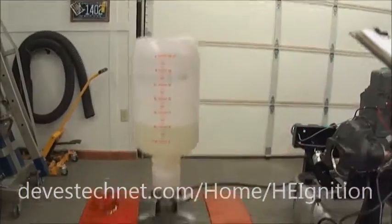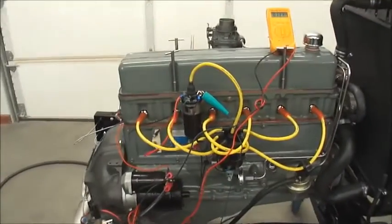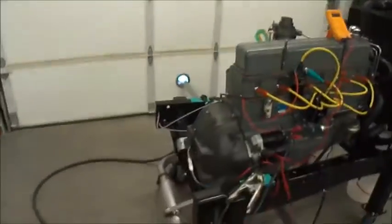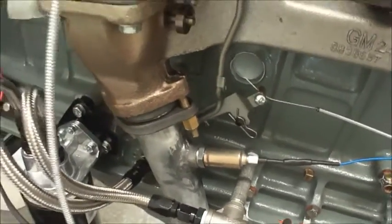As you can see, there's a bottle on top of the gas tank that has the ounce gradations, a standard set of gauges, and we're going to include an O2 sensor in this project. The O2 sensor will be read with a Fluke multimeter. It's a narrow band — I made a harness for it with test points and a USB connector to get it apart when I'm not using it. Here we can see the O2 sensor; it's a standard SG5.